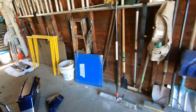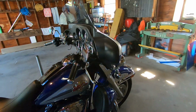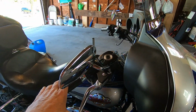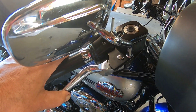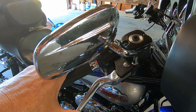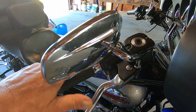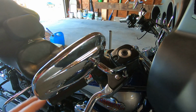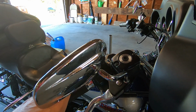Oh yeah, I mentioned front brakes. Well, yeah, I had a problem with brake lights. My brake lights were sticking on. What was happening was, on the front brake lever, I would pull it in, the brake lights would come on, but then it wasn't coming all the way back out on its own like it does now. And it comes all the way out on its own now and turns the switch off. Before it was sticking, I'd have to push it forward. It may not stay forward.